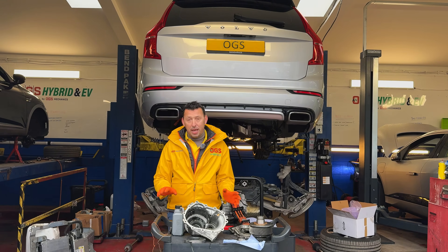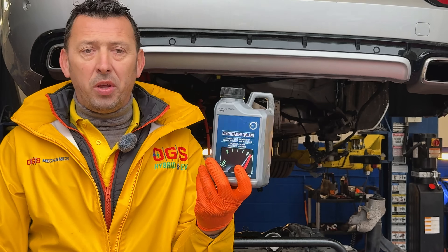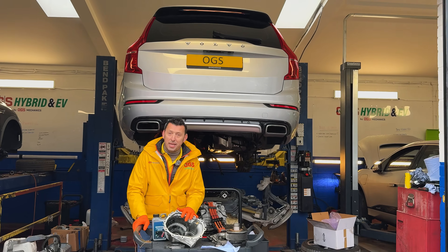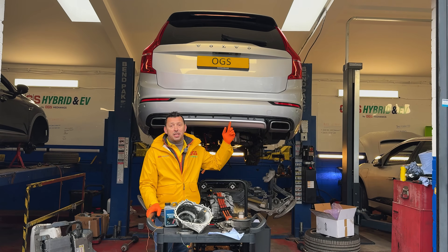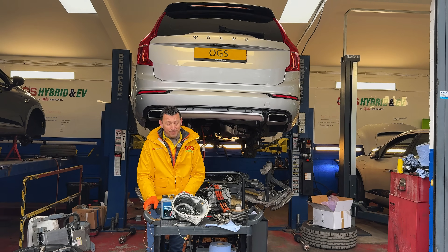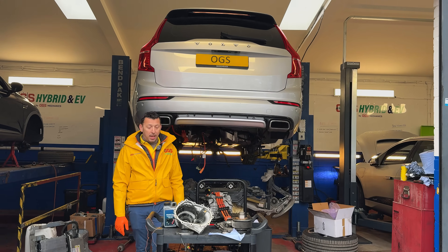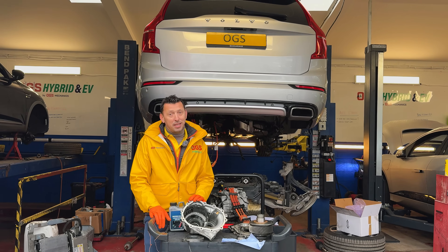It's only the oil. This is the oil that should be used on the rear diff — it's a transmission oil, just from Volvo. Normally the unit takes about 0.8 litres. An interesting fact is that Volvo initially said this is a lifetime fill — it doesn't need maintenance. Well, that's not really the case, because these units were failing at a very high rate. Most of the time, generation 1 failed well below 100,000 miles. The cause of this was the heat. The second cause is the usage, and we'll get to that.